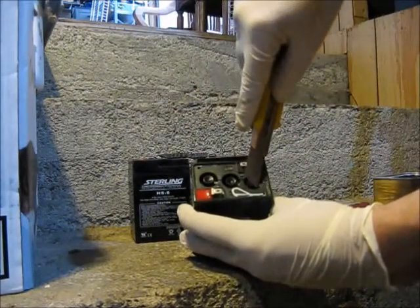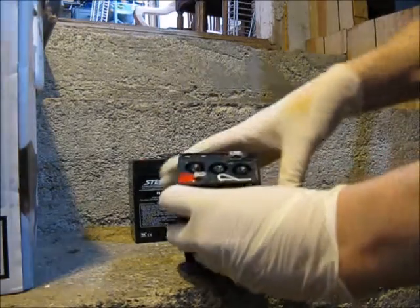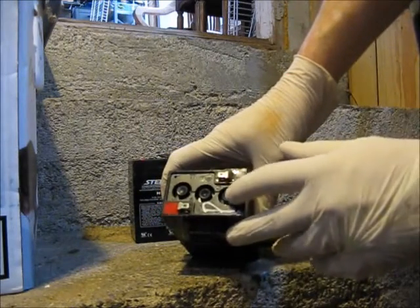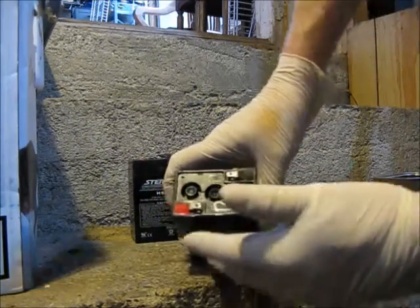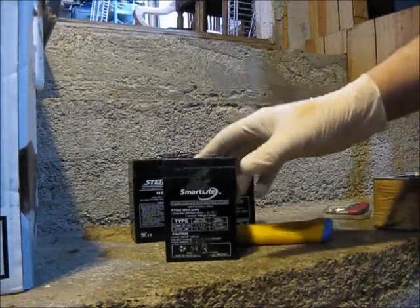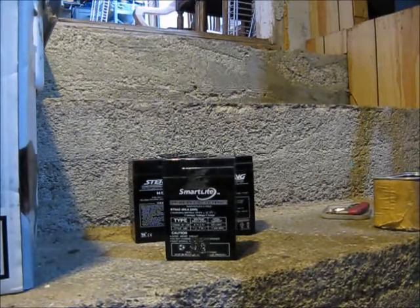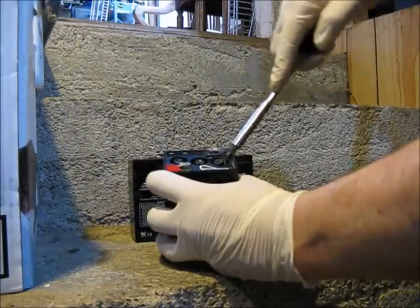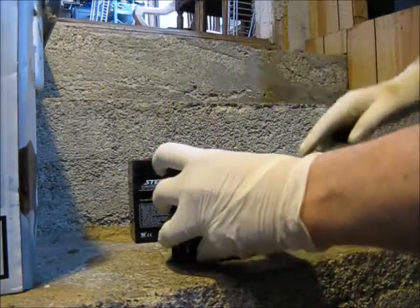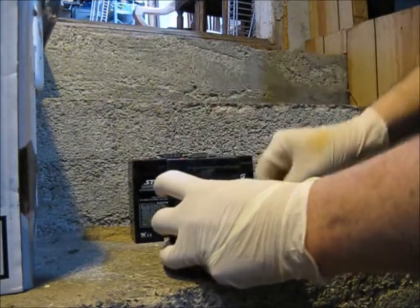On the battery you can see it's just little rubber caps, same thing like the old school batteries used to have. Each one of those is dimpled in — usually they're flat across — so you know that it's purged out a lot of gas. That's what makes these things maintenance-free or spill-free, but also that's where you can just top them up with some acid and they should be good as new. Pop off the caps: one, two, three. They make a nice little suction noise when you pop them off, so you know they're depleted of fluid.